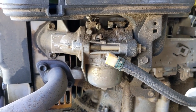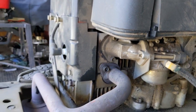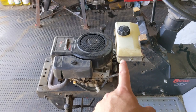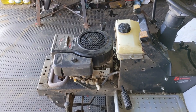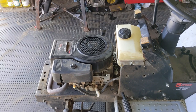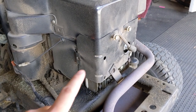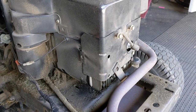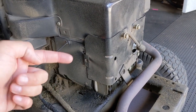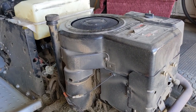On this particular engine you can see the intake manifold here leads directly into the cylinder. We also have what's referred to as a gravity fed fuel system — the fuel tank is mounted higher than the carburetor, so gravity flows the fuel down. The more fuel you have, the more pressure you're going to have at the end of that line. Once the fuel starts to fill the cylinder, it will eventually seep past the piston rings and down into the bottom end or crankcase of the engine, which is what starts to dilute your oil.